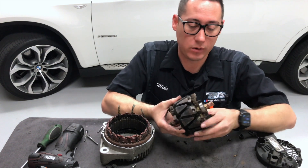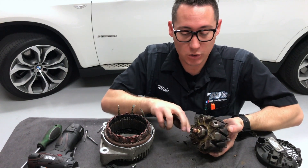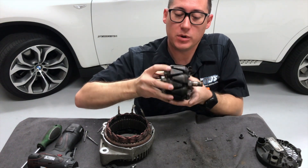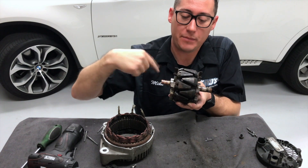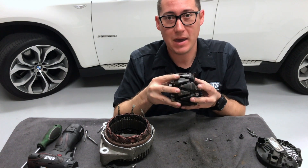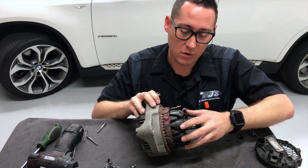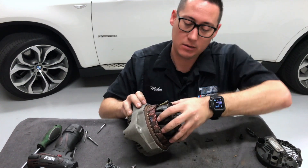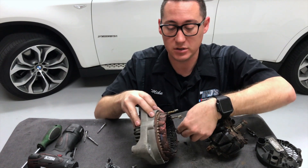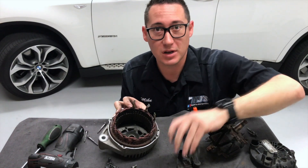This here is what they call a rotor. Correction from earlier — electricity from the actual car battery goes straight to these two copper rings, and inside there's a bunch of wire wrapped around. So when the battery voltage is applied, it turns this thing into basically a very strong magnet. When it rotates inside the housing inside the stator, the rotational magnetic fields excite the stator coil and the voltage is collected. There are three of these, so it's a three-phase alternator, and it comes through here and goes into all the little electrical components we talked about earlier.